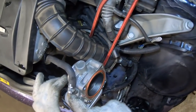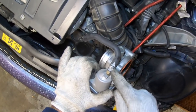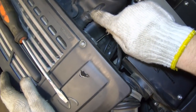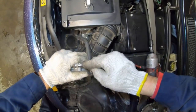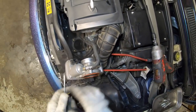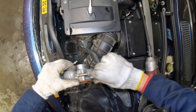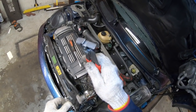This coolant hose is held on by a single-use crimp on the automatic car. On manual cars, this is usually a reusable pinch clip. This one shouldn't be on terribly tight, and I don't have a replacement clip, so I'm going to loosen it enough to get it off. I've got a crimp tool which I'll use to re-tighten that clip — I'll put a link in the description where you can pick up this tool.